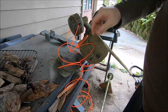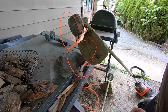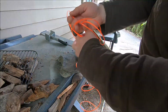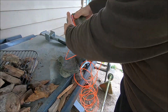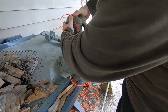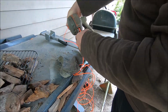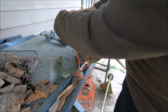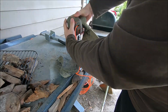Okay, guys, now we've got the line even in length on both sides by setting it on the ground. Now, the daunting task is to wind your line in counterclockwise. Once you wind it in a little bit, you might want to pull on it a little bit to make sure it's tight in there. Wind it a little bit, pull on it, wind it a little bit,